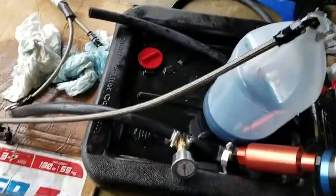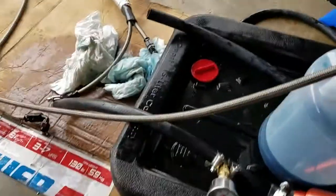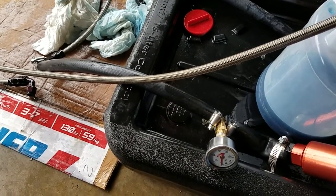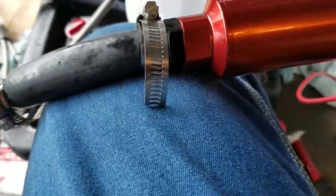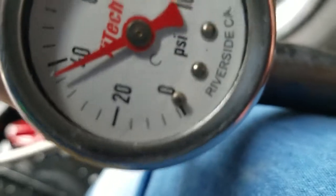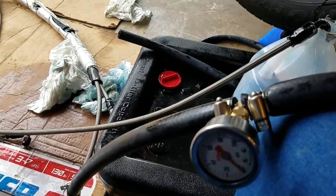This is the last line to test. After that I'll reassemble and test the system in series again. Someone suggested running the two coolers in parallel, but I don't know how well that would work — if the fluid on one side would just stagnate or something. Running the last line: 35 to 40 pounds, and it is just running away with fluid. These two lines are a bit longer. I wonder if running dash-8 lines for transmissions is a thing.